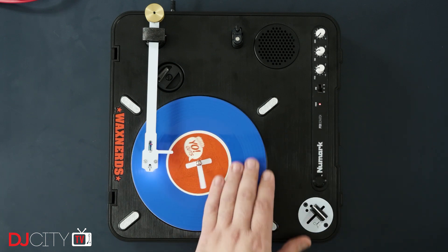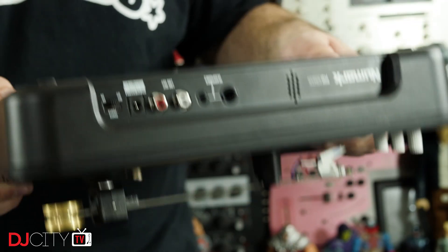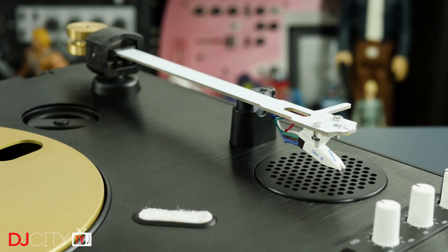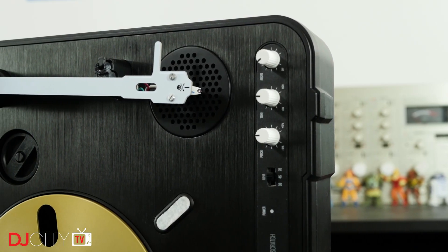There's no restriction on the movement of the arm, so you can move it across to the other side of the record — much more comfortable for those who use their right hand on the vinyl for scratching. The kit comes with a magnetic adapter for the tonearm clip, which connects to a magnet in the arm. I had doubts about this at first as it seemed a little loose, but as you can see it holds in place very well. The PCB arm comes in a kit with a preamp, which you'll need for a regular magnetic cartridge, and the whole kit can be installed with no soldering — ideal for clumsy people like myself.